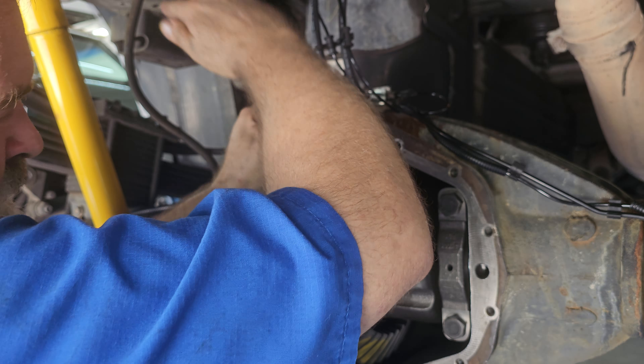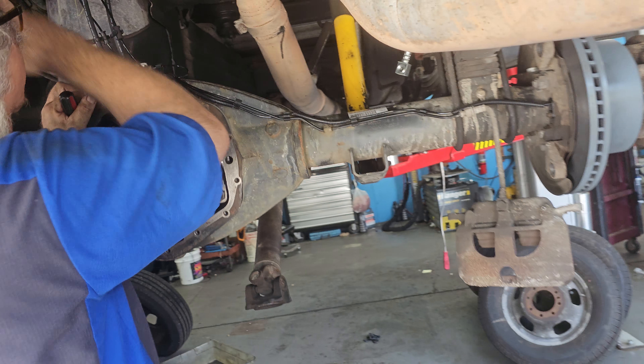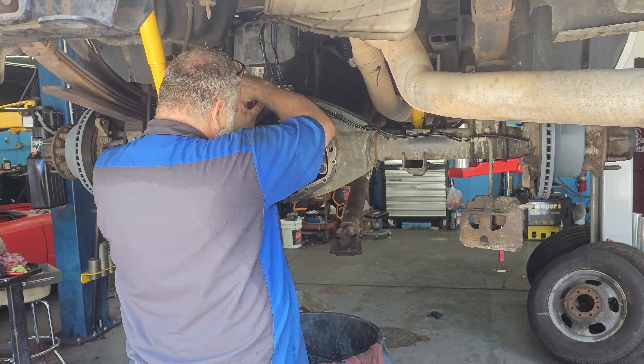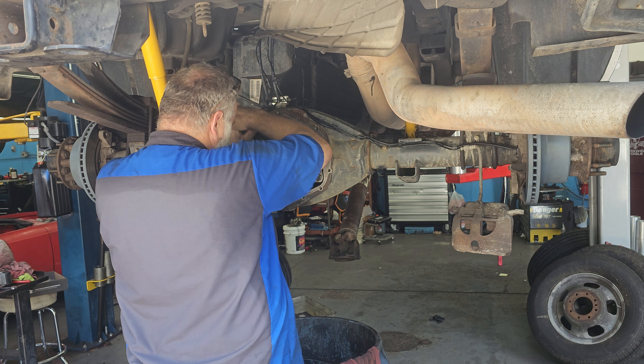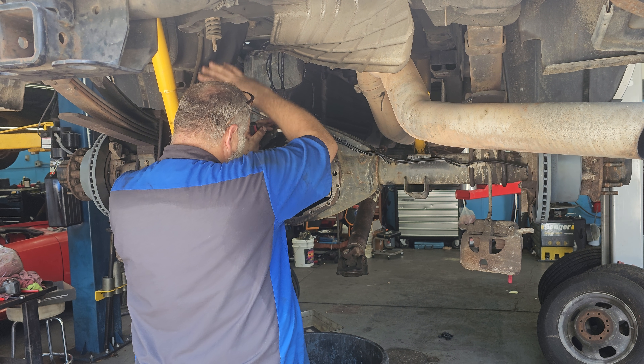It'll bind. So if you've got a ring and pinion, it's not as simple as just putting it together. You've got to actually measure things and make sure that you get the right depth. If you've got a ring and pinion and you need it set up properly, bring it to PALS. See you soon.